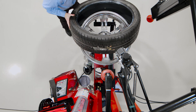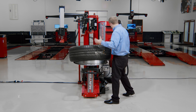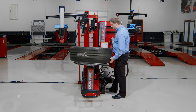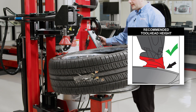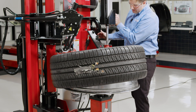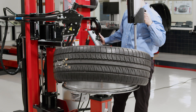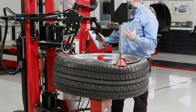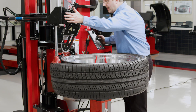I'll lift that up. Sometimes these bottom beads will just push right on on these really large diameter assemblies. Drop center, drop center, drop center — I just want to make sure that I'm keeping this tire tracking in the drop center all the way around while I'm mounting it. I'll bring down my roller and my bead press and start to rotate around. I can adjust each independently as I need, and rotate just as fast or as slowly as I need as tension starts to build and get this tire mounted up.